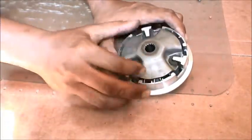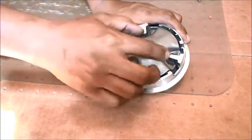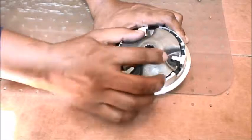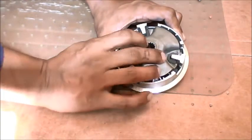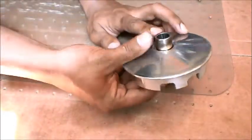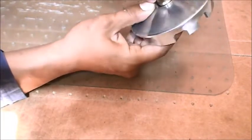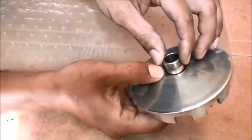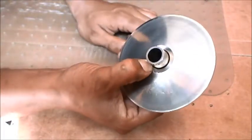Put the cover on. One thing I don't like about it is that compared to the OEM one, the back of the variator plate fits on there loose — slides around a lot. I like how the stock one pressed in. The easiest thing to keep all the roller weights in there is to keep pressure all the way back and use your thumb to press down on the center shaft. Don't lube this — the OEM one comes lubed, but this is a tight fit. If you lube it, the lube will spin out and hit the dry face, and your belt will start slipping.